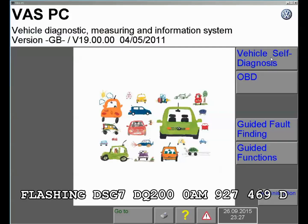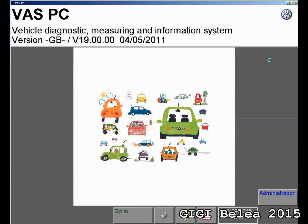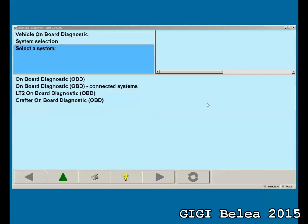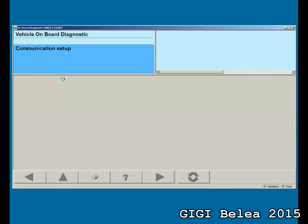We are going to the self-diagnosis and see what's going to happen here. We go to the onboard diagnostics. It will take a little bit of time until all the components are gathered up. I have nothing connected to the flash cable — I just have the bus head and the mechatronic unit connected.